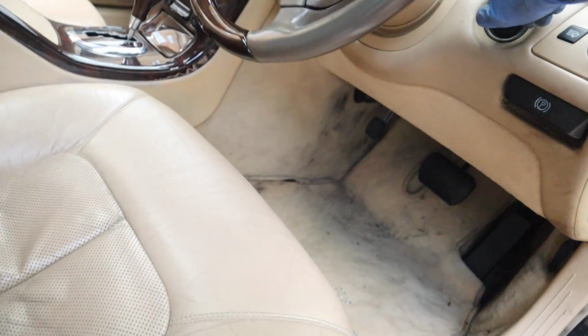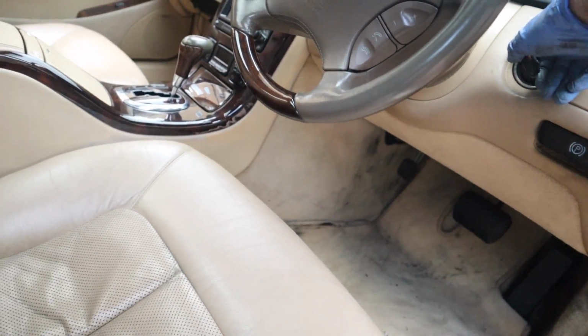Right, I've got a theory. I think it's gone that low on the back that it's gone past the sensor's threshold, potentially, and it's that low that it just thinks it's broke and it's not coming up and down. So I'm going to take them off and raise them both quite a bit, quite high, and then see if it's working again. Part of me thinks it might be that. Okay, so I've raised the rear arms, putting them back to probably the highest that they could go. I'll start the car, and I pray now it lifts the back.